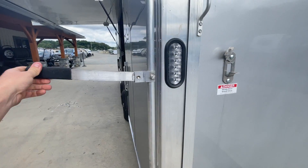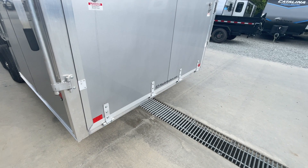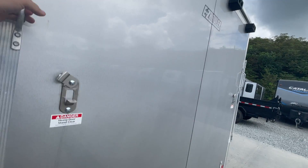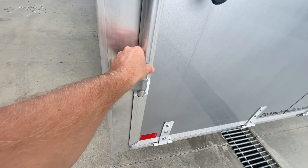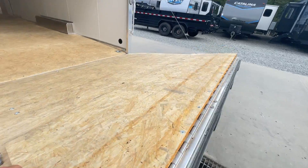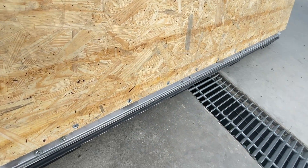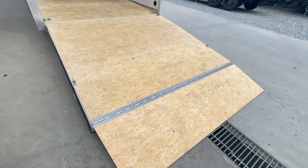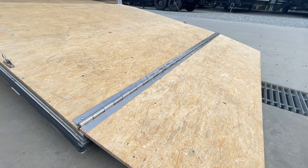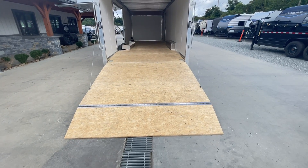Rear hardware is also aluminum — fairly simple to open up and deploy. Dual aluminum grab handles. You've got four hinges at the back bottom, and four bumpers at the top — those are the oversized heavy-duty ones. Even the little details: slip joints from where it would wear — nice little detail. Clear lens lights. They also give you an oversized ramp flap extension, lagged in a little heavier than some we see. Very heavy-duty hinge as well. If you look around the industry, this is done a little bit differently — normally you're going to get about a 1-foot extension with a much lighter hinge. That extension here is probably 18 to 20 inches.